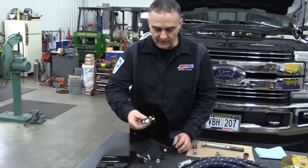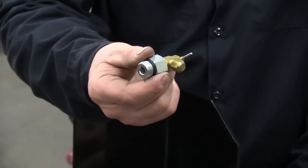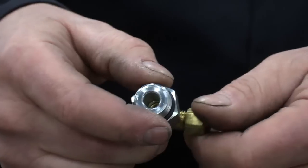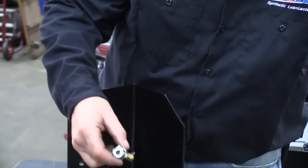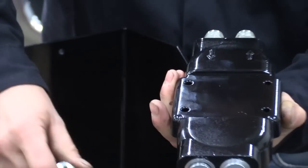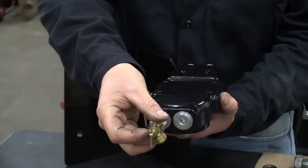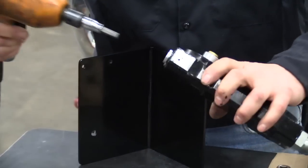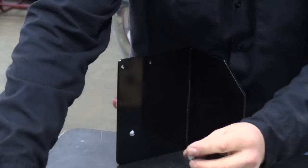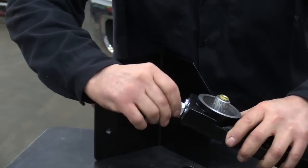We also have the oil sample valve. This makes it easy to take samples on the engine oil. Basically it'll take you five minutes to take a sample, and you do it with the engine running. I've got a cap on here to keep the valve clean and the sample clean. That goes into the filter head — now, there's a little issue here: AMSOIL uses Loctite to put in these plugs, and when you go to put this oil sample valve in, the dirty oil passage is right here — that's where you want to put it. I'm going to take this out with a half-inch impact running quite a bit of air pressure. These do not come out nice — I had the hammer on it a bit to get it started before we began. They put Loctite on it and they're rather hard to get out, so that's something to be aware of. This fitting will go right in place of that, and that will be your place for the oil sample valve.